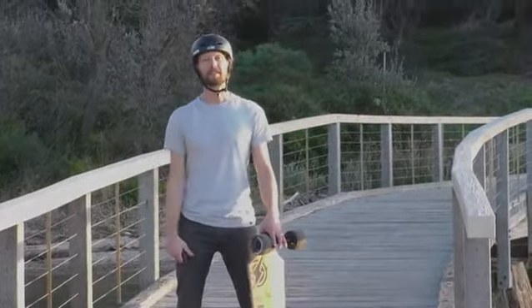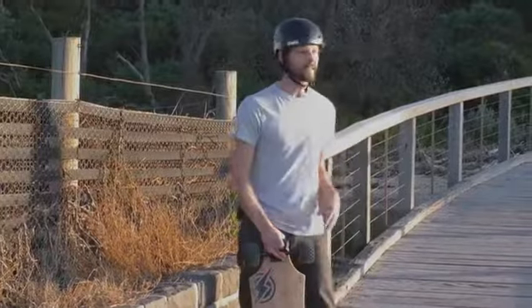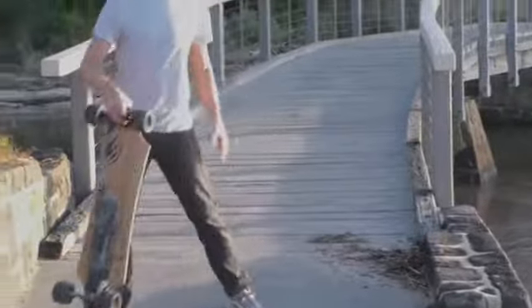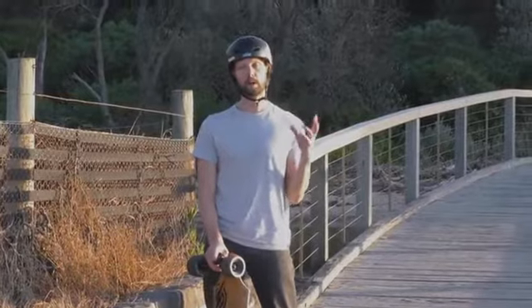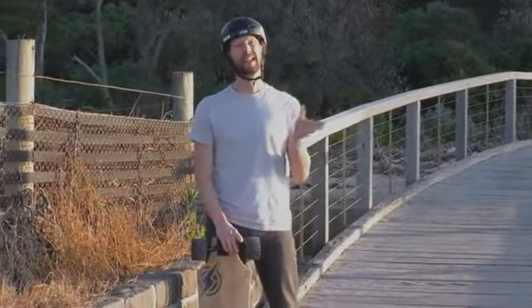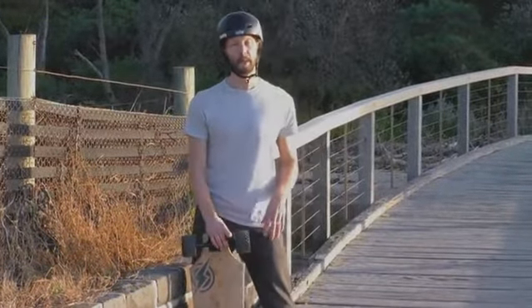Just to summarize: we've gotten a little bit wet, and that's actually okay in terms of splash resistance. It's not full IP67 water resistance, so don't ride in the rain — water can get down through the screw holes. It's not fully waterproof. But splashing in and out and getting a little spray on it, that's generally not a problem. Just make sure water's not actually getting into the battery box.